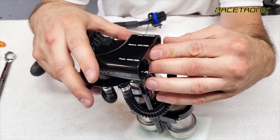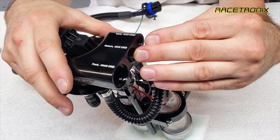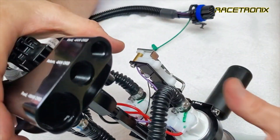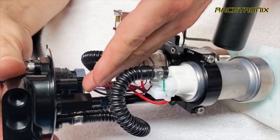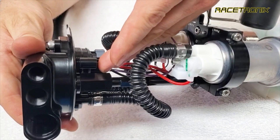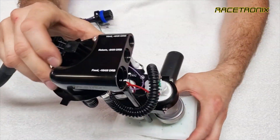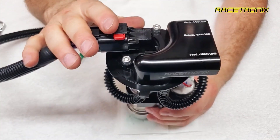The return is your standard dash six, which we used in the past, which is adequate for stage pumps, and we also have a dash four ORB port for the tank venting. The vent has a custom one-way valve on the bottom that allows vapors to escape from the tank, but in the unfortunate situation if the vehicle were to flip over, the check valve will block the fuel flow so it cannot drain out of the tank.